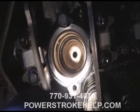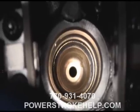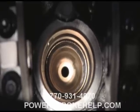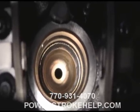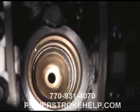So with each hole nice and dry, it should be relatively easy to see the coolant emerge. After the system is pumped up, you can see the coolant form and push down into the cup. It's a very small hole. You've got to be very patient and keep the system pressurized. It's helpful to have a friend pump the system while you're observing each individual cup.